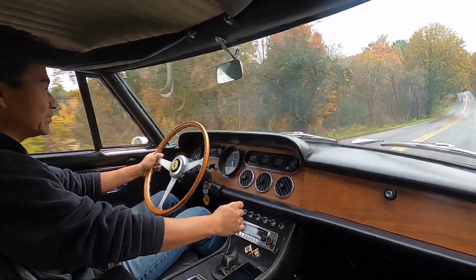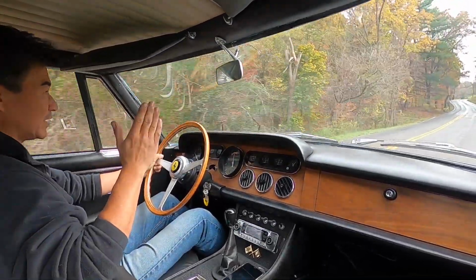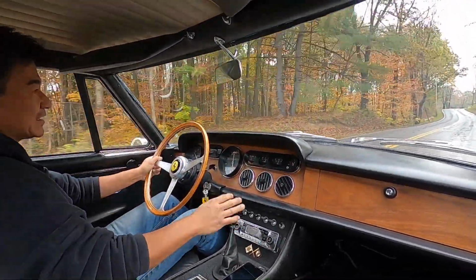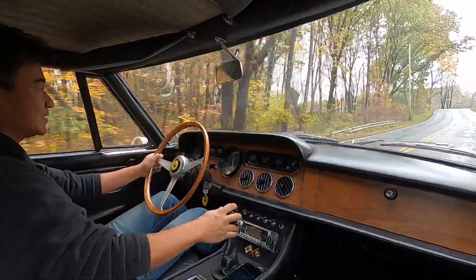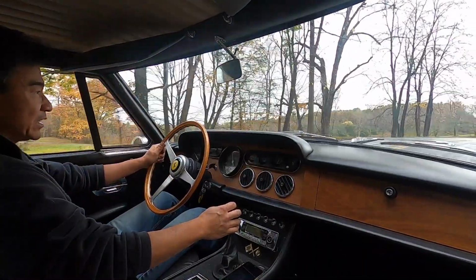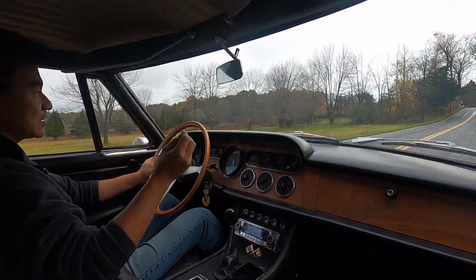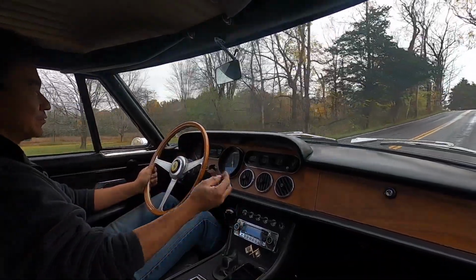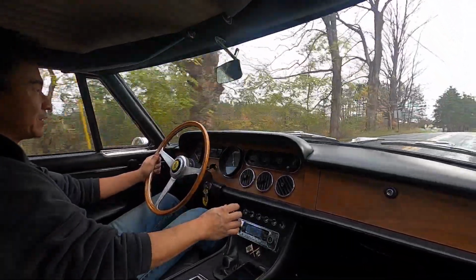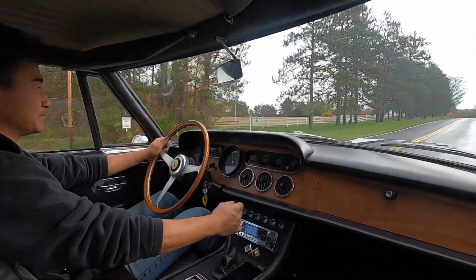It's probably vacuum leaks. When you think about that slow idle, that's kind of lazy to come back down, it's probably because air is getting sucked into the base plates. And what ends up happening is when I go on the accelerator, you're sucking more air in through the base plates, not through the metering. So what happens is you get popping and spitting because it's running lean.